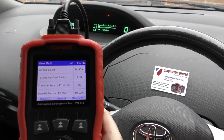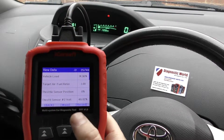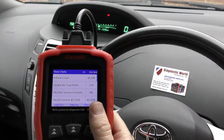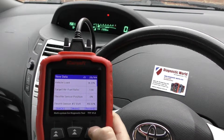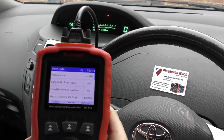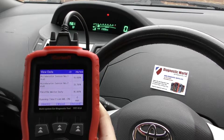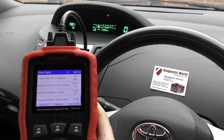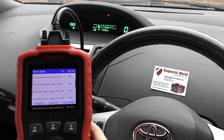We can scroll down and pick off different bits of information — RPM is just under 600, air intake at 26 degrees, MAF at 1.14, throttle sensor voltage, and O2 sensor information. The good thing about this tool is that you can actually record data as well. You may need to capture certain sensor readings while the car is running, so you'd record the data while driving. There's 144 parameters in total so I won't go through them all.